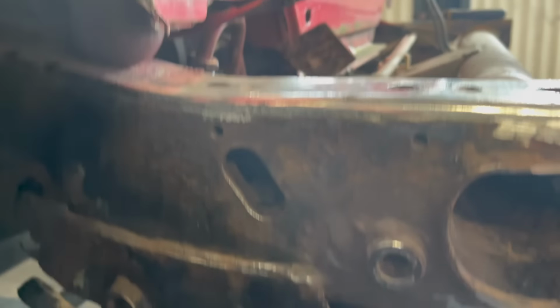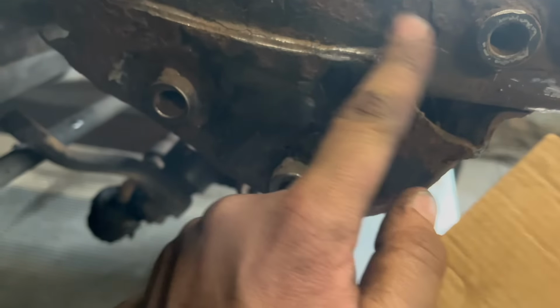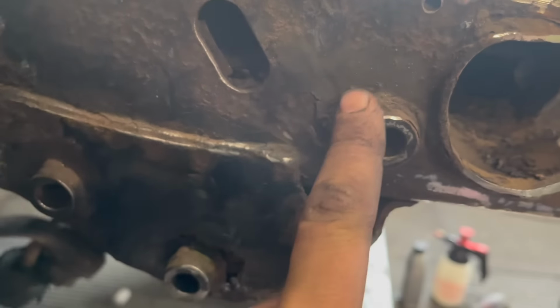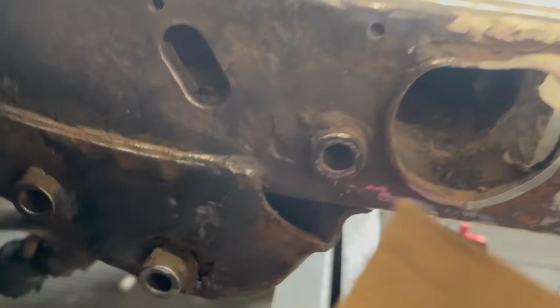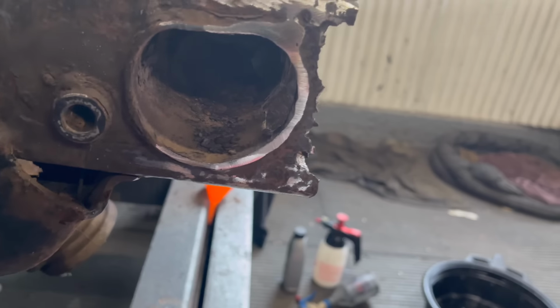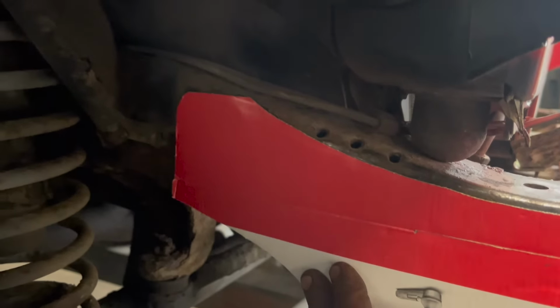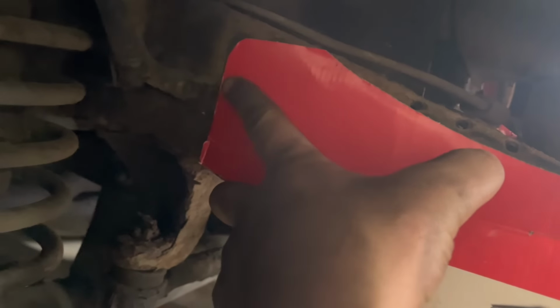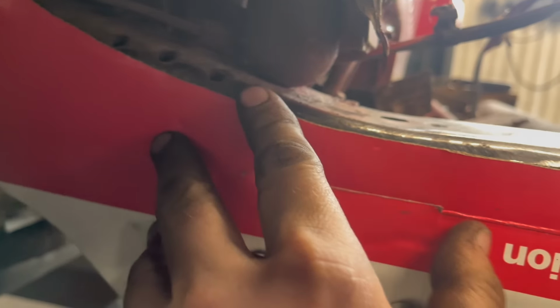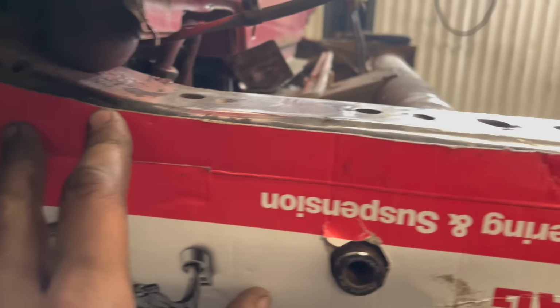Clean back. It's pretty good, this. In all fairness, just a bit scabby there. But I'm gonna get in with a wire wheel and get all this clean back. So I'm gonna weave welding round here and wipe round here. This is basically the wrong way around. This is my lovely template. So I'm going right back to where I can get a good weld along there. I'm gonna come all the way down here, level it up, weld all the way down here.